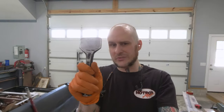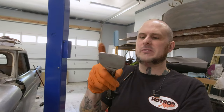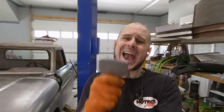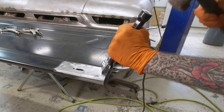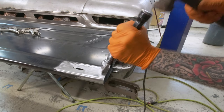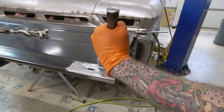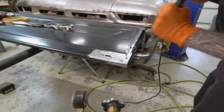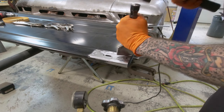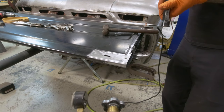I'm going to go ahead and use this tool. This is a concrete breaking chisel — a block chisel that I rounded the end off of and radiused a little bit so that I can use it for this exact kind of purpose. What I'm doing is using this thing as a corking tool, chasing along the body line to crisp it up with the tool and the hammer. As I go around the corner, I quicken my pace and do lighter hammer blows but more rapidly. The idea is I want to shape that corner in, slowly turning the chisel around that corner to create the radius corner that's supposed to be there and crisp it up so it'll look much better.